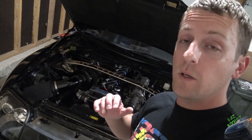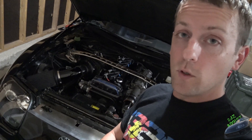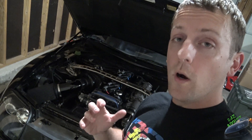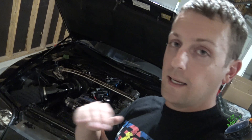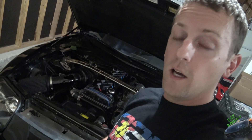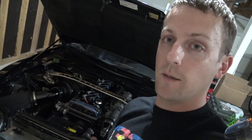Before we get started I'm going to make a few assumptions. Assumption number one: I'm going to assume that you've already got an engine stand. If you are using an engine stand, I highly recommend using the 7M head bolts because they're a great length to hold the block to the stand itself — pro tip. Second assumption: you're going to have a professional machine shop do all the machining — bore if it needs it, hone, line hone if you're running billet mains, deck it, hot tank it, all that stuff. Assumption number three: you have a basic set of hand tools including a set of 12-point metric sockets. And finally, I'm also going to assume that you have a torque wrench, because everybody needs a torque wrench.